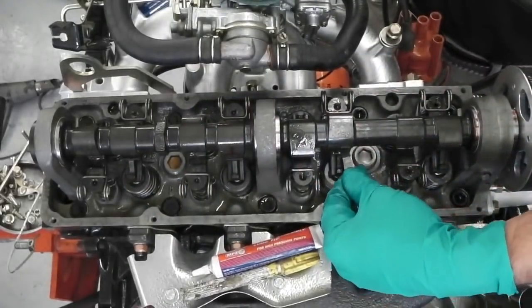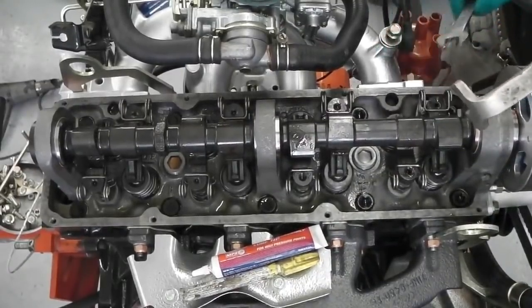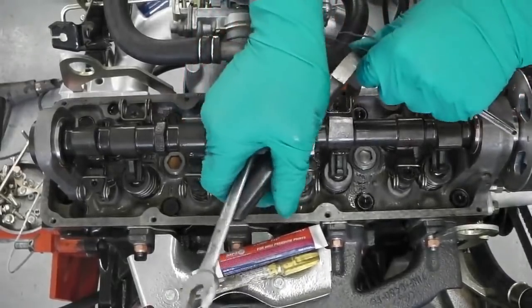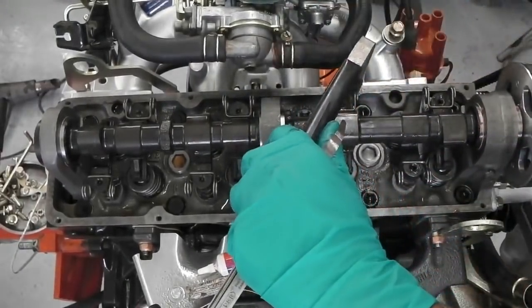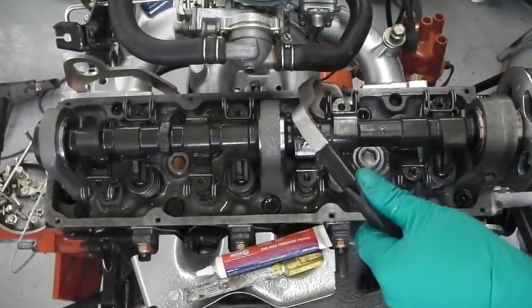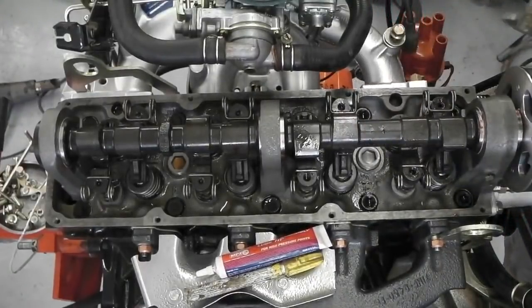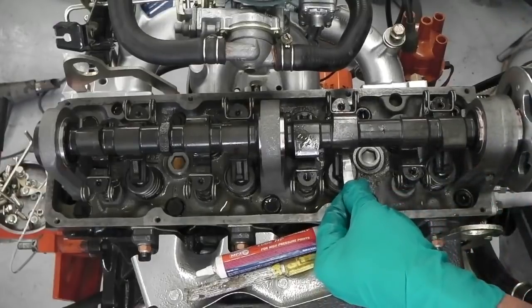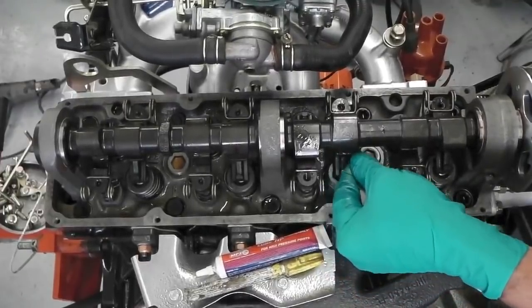So this one, you put the feeler gauges under, now it's a little bit tight, that one. So we need to turn the 15mm, first loosen off the 19 if it's tight, the lock nut. So we undo this lock nut. That's what you've got the crow's foot for. Like that. That releases the locking nut. We can now turn it down a little bit till we can get the 15mm. Sorry, this is an exhaust, so we want it on 25, not 15, 25, a 20 and a 5. Still a bit tight going in, just about going in. Quite a snug fit, you could say that's all right actually.